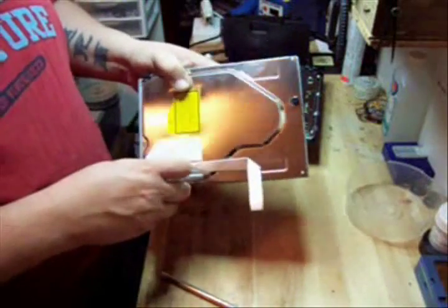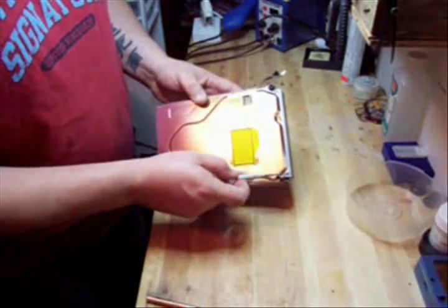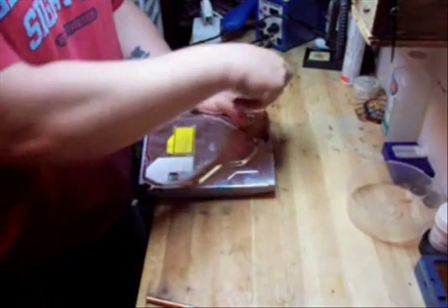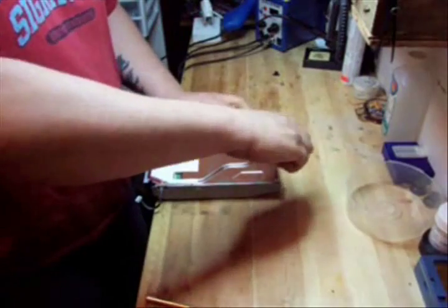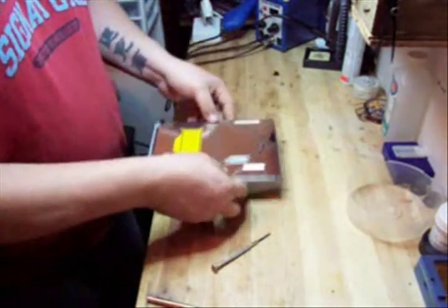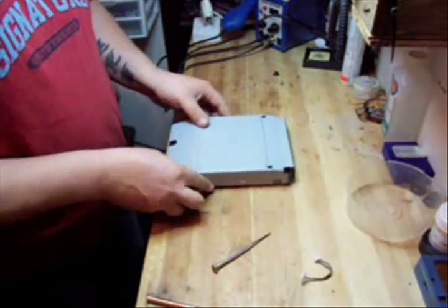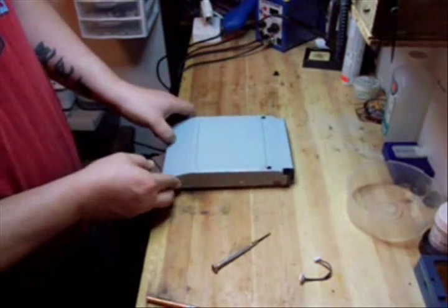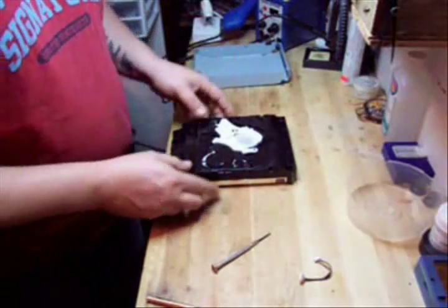Lift up on the little clip for this side of the ribbon cable. There are three screws along the top — you're only going to take out the M2 screws. Then flip it around; there are two screws on the bottom side, one on each end — take those two out. Flip it over, unplug your wire. Put your thumb in the black hole and lift up on the back of the case, and that top metal casing should come right off. Put that to the side.